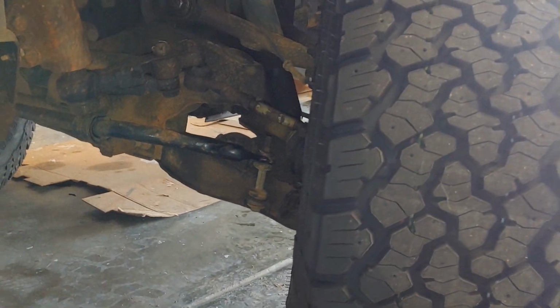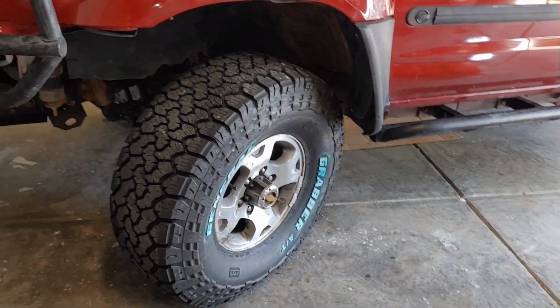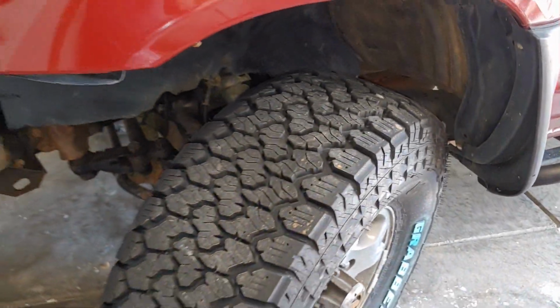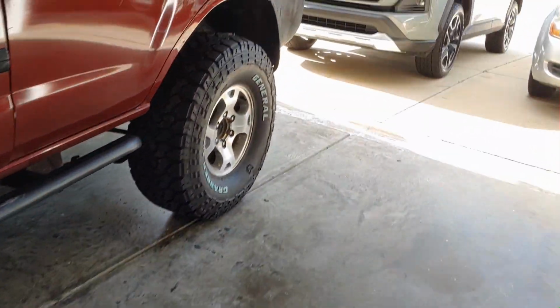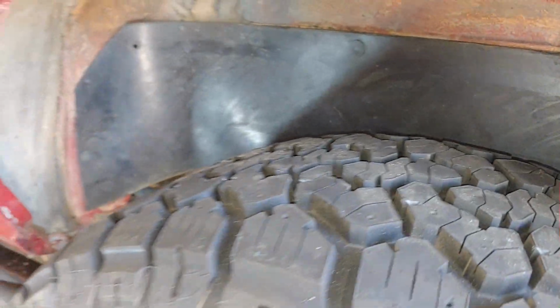And so when someone says, yeah, those tires fit, you really got to understand what it takes to make them fit. Sure, I can clear them. You can trim the plastic there. You can adjust the steering stops out. You might have to run a wheel spacer in the rear to make sure that it doesn't rub up on the frame rail over here.